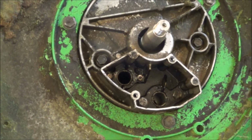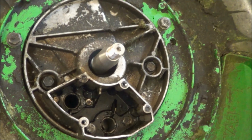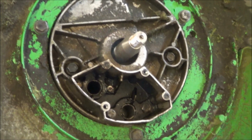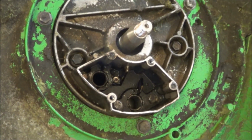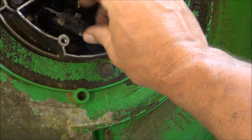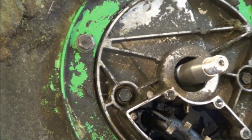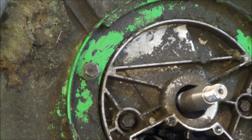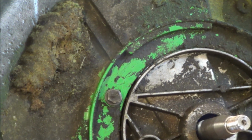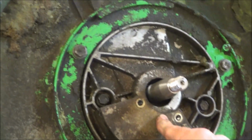Okay, just put on the exhaust first, and then you mount the motor to your exhaust plate. It's kind of a challenge compared to taking it apart. It takes a little finagling, and I forgot to put the exhaust manifold gasket in place. This is the little piece that goes there, and that's held on with a little cap. I'm just going to reuse this, and if it leaks, it leaks. I think this is kind of a way of quieting the motor down with a little baffle or something here.